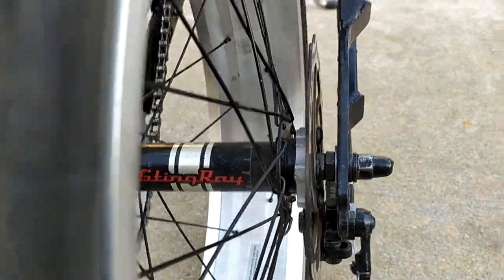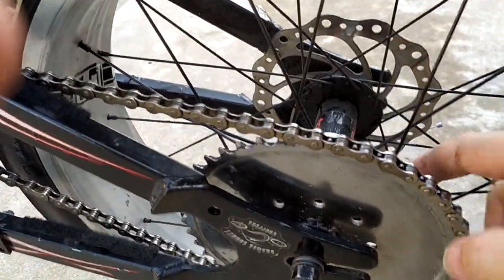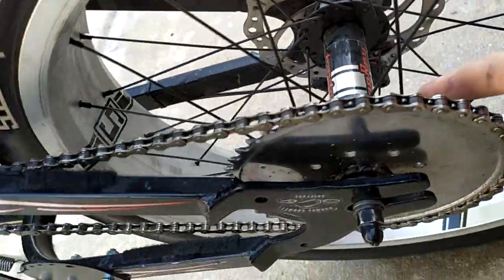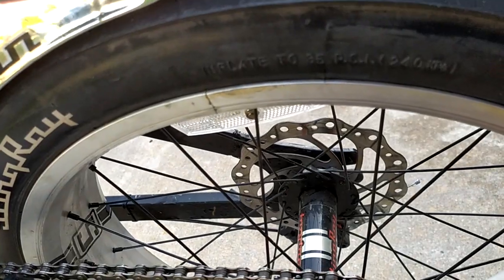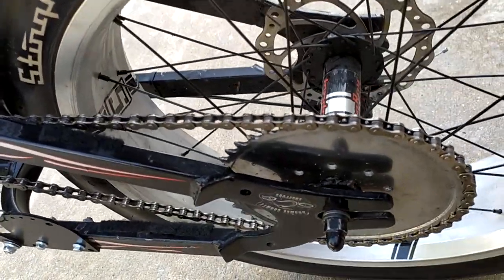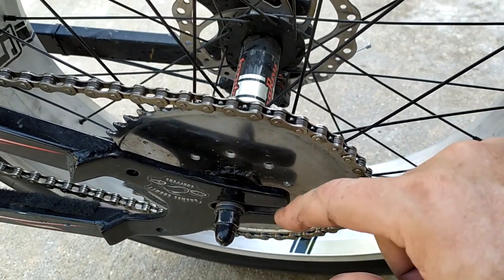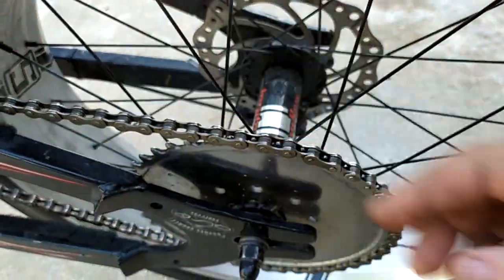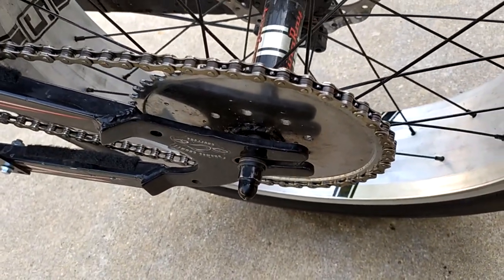For the motor sprocket — the sprocket adapter didn't fit because of the big giant hub inside the wheel. The kit's rubber plate and bracket system (look it up on Amazon, as seen on Project Farm) just doesn't work here, and even if it did, moving the bracket over would make it rub against the fender. So I had to weld it. I used Project Farm's tie-wrap trick to get it level: tack it once, spin it, check if it's straight, tack the other spot, spin again, and keep going until it's perfect. It's welded enough that it won't go anywhere, but not so much that it's permanent.